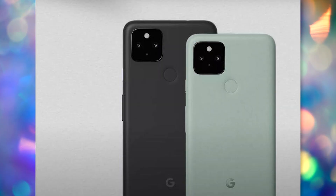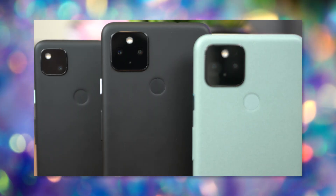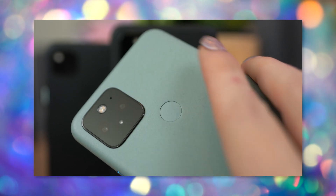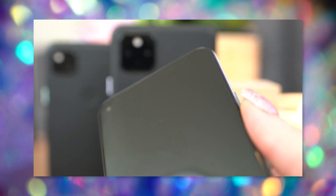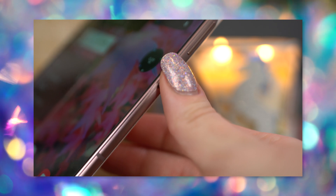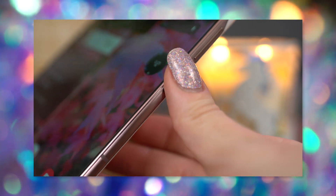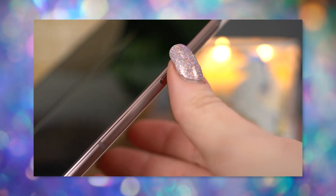The next one is capacitive sensors. These are more common and found on a lot of different phones. They measure your finger using human conductivity by creating an electrostatic field and generating a digital image based on that field. They use tiny capacitor array circuits which track details in your fingerprint. Ridges, whenever placed on a conductive plate, create changes in the charge stored in the capacitor. Valleys, on the other hand, leave the charge unchanged. There's also an amplifier integrator circuit that can track changes and record them with an analog-to-digital converter so digital data can get analyzed.